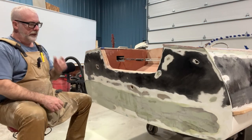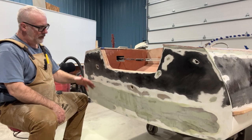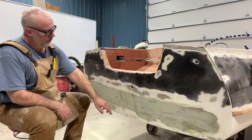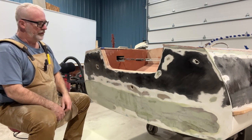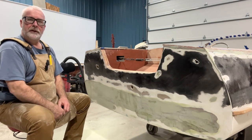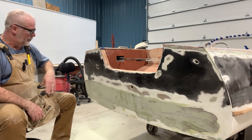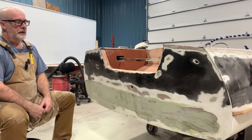I've completed the first longboard foam pad sanding with 80 grit sandpaper. I can still see some low spots — very shallow — but I don't want to go into the opposite sides of the repair. I've got into the first coat, which would have been probably the original clear gel coat of the boat, and I'm hitting white on the primer, so I know I'm getting close. It shows me that I need to put more filler into this low spot. I'm very happy that for the most part it's very minor additions of Total Fair by Total Boat. I'll go ahead and put another application in and it'll be another light sanding. That took me about an hour of longboarding, and that's normal.